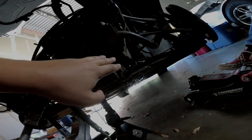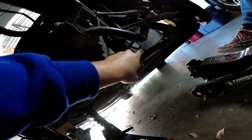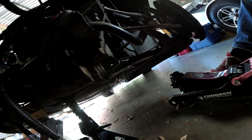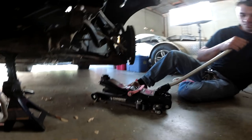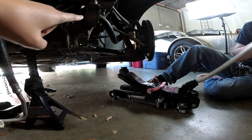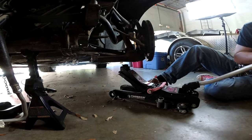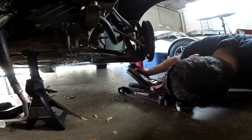Now let's take you over to that C6 Corvette — oh yeah, make sure you hit that like button. So as you guys saw already, it's cracked right here. This whole entire subframe needs to be removed, and that's going to be one heck of a task. But first we want to remove the leaf spring, which is right here. In order to do that, they do make a leaf spring compression tool, but instead Mike is jacking the car up in the corner to relieve some of the tension off the leaf spring. That way when we remove it and lower the jack, there will be no tension on it and we'll be able to just pull it out.